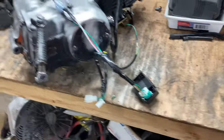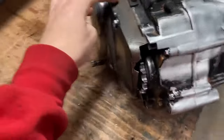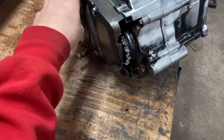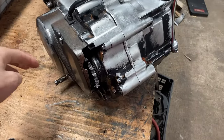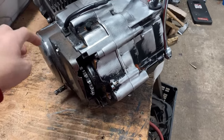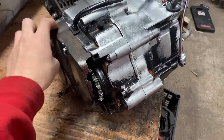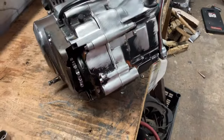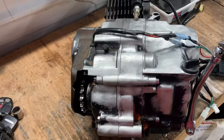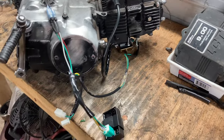When you're ordering this, I got this kit off Amazon for 16 bucks. It only comes with a wiring harness — it doesn't come with the internal components inside the motor. When I first plugged it in, no spark. Obviously we had something bad inside. I went ahead and took it apart and luckily I had some of the pieces that go in there. I plugged those in, plugged everything back up, and we had good spark. The wiring harness itself was good. So if you plug this in and you don't have spark, most likely it's going to be the internal parts — you'll need to replace those. You can probably replace them for under 25 bucks.